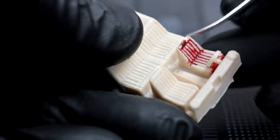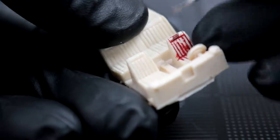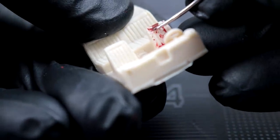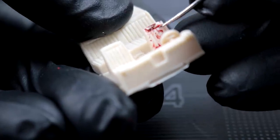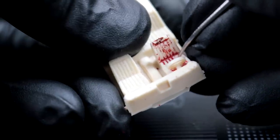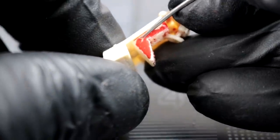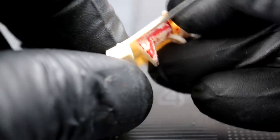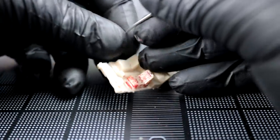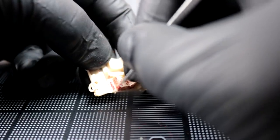For the past half hour I've been very gently scraping away this paint, contemplating life, wondering what I did wrong to deserve this. I got most of the paint off. I tried soaking it with brake fluid again for a little while, but after about half an hour I just didn't have extra time to wait on it. Luckily it comes off pretty easy — just using the side of my pick like this. Coming off pretty clean, so I probably won't paint it after all. I'd rather have the white interior because it's factory and it's going to look better with the paint.